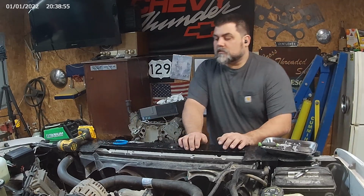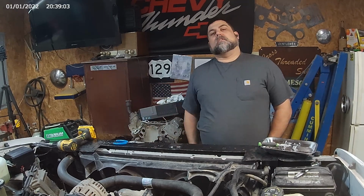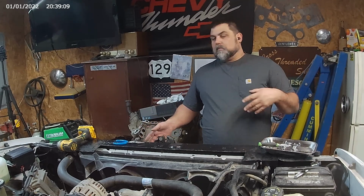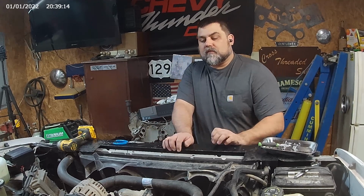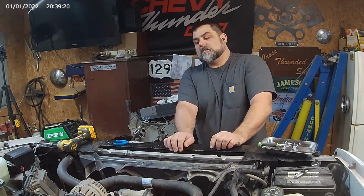Drain coolant. As y'all know, once you start draining coolant, it doesn't go as planned. It's supposed to come out the petcock, it's supposed to get out of the drain, but it goes everywhere. Once you think you have it all drained, then you dump some more out. So I got some floor dry and a drain bucket to catch some of it. It's making a mess because I gotta get this water pump off anyway to get the cam out. I gotta take the steam line off the old throttle body.